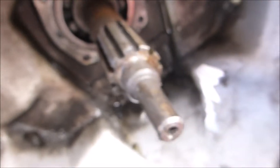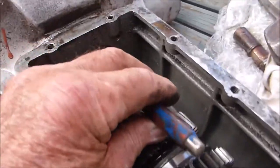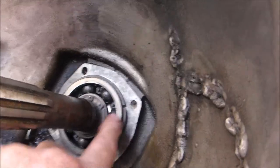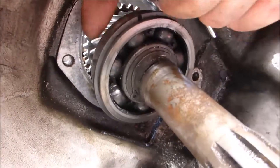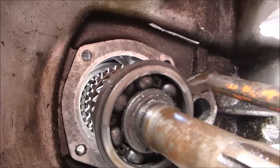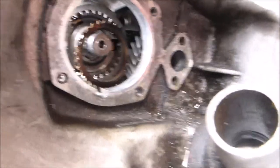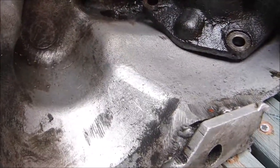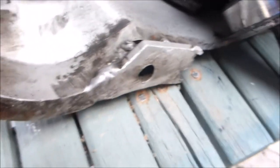The next thing is to tap it this way and take it right out — a couple of taps with a punch just in there and, because it's well lubricated, it will pull this out. You can see it's separated there already. You may find that the top will come out further; I've used a bar with a small crank on the end just to level it up, and then out she comes. Now just take out this brass piece — make sure to keep it the right way round. Keep them together and that's all ready.